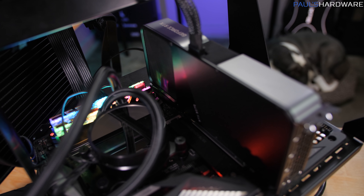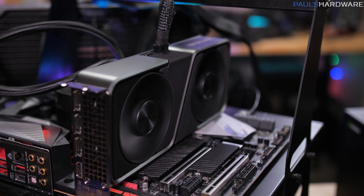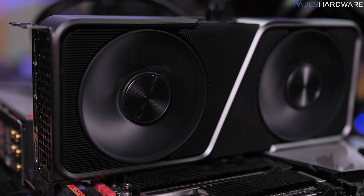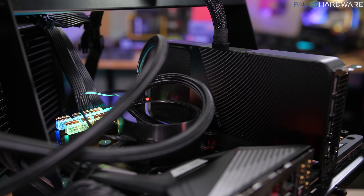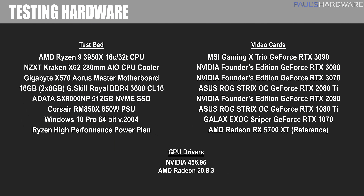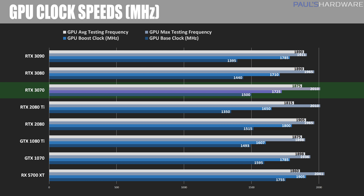All tests were run on my AMD testbed, sticking with the 3950X running at 4.4 to 4.7 GHz with Auto-OC and PBO enabled, cooled by an NZXT Kraken X62 280mm all-in-one CPU cooler. Here are the actual clock speeds I was seeing from the cards while in use. The OC versions of third-party cards like the GTX 1070 and RTX 2080 Ti are running with their out-of-the-box manufacturer overclock. The 3070 had a higher peak frequency than the 3080 or 3090, hitting 2010 MHz, but on average it ran a little bit slower at 1875 MHz.